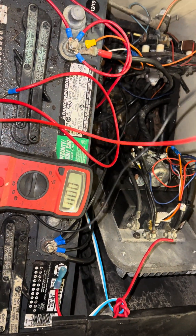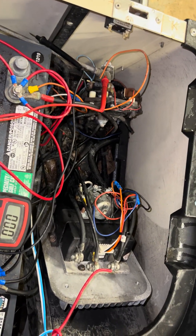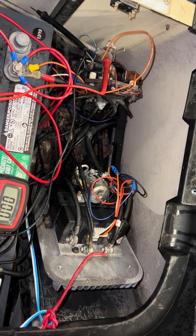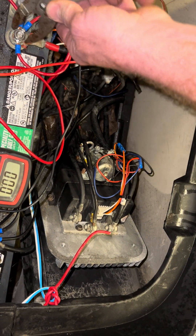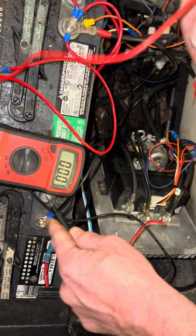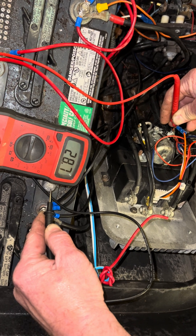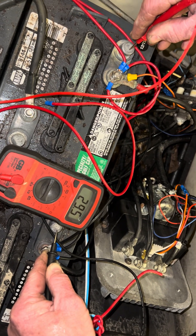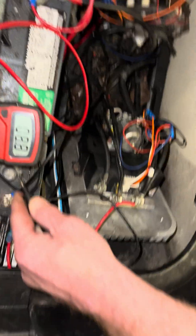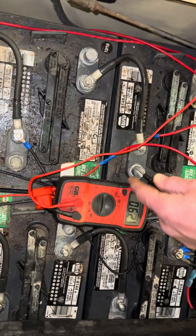And now the car don't run because that wire is loose. I'm trying to make a video so I'm just going to tighten it up — I don't recommend tightening it by this unless you got to. Being a mechanic, doing what you can. Then we're going to go back here, black lead main negative, red lead on the red small post on the solenoid. Hit the gas — you got battery voltage. And battery went dead that quick, it was just 35.